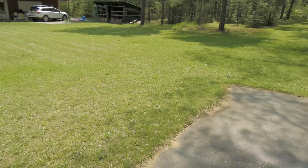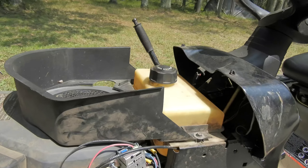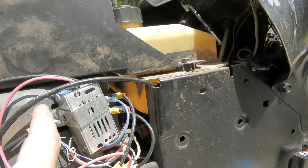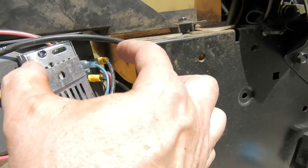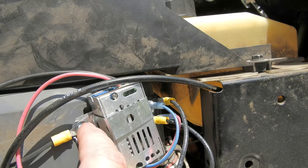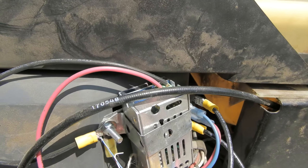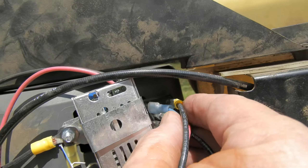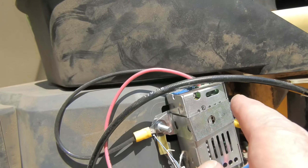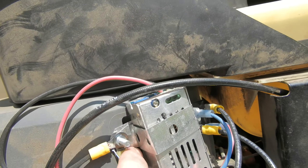I just cut my lawn and the new regulator system is working fine. The old regulator bolt holes and this regulator's bolt holes are almost the same — there's like a hole and another little hole there, it almost would fit perfectly. But the hardware is much smaller and there's clearance issues between the board and the base of the unit. So I put it on kind of sideways, and that way I had a place to use the other bolt for the full bridge rectifier. And I'm getting a little bit of cowl ventilation onto the unit — see the hole in the cowl for the regulator.